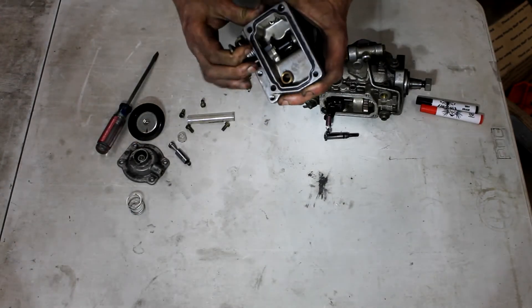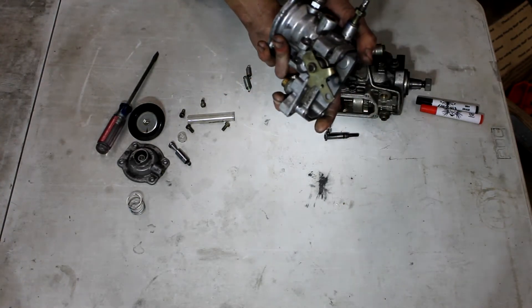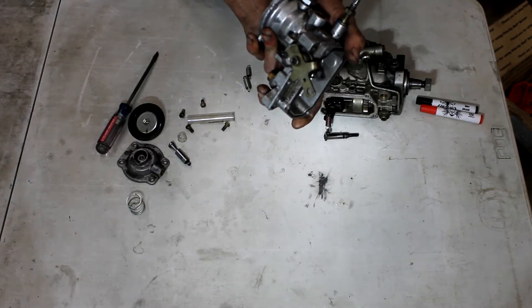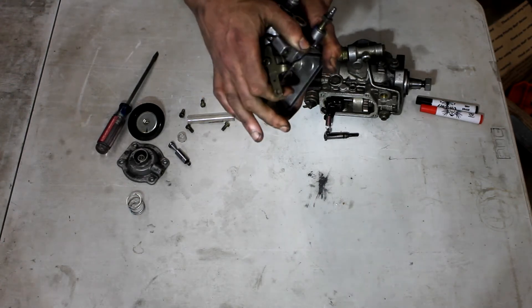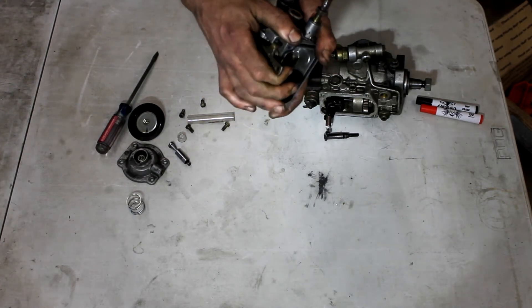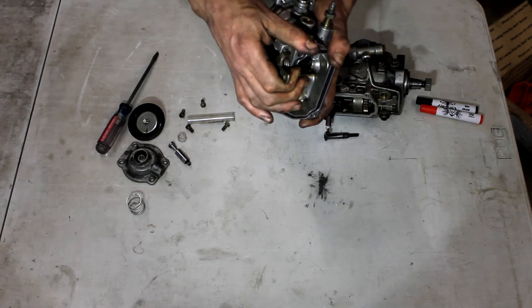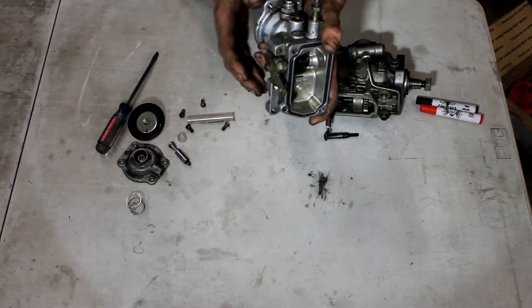This is your mechanical shutoff. When this is in the truck and you don't have the electronic shutoff working or there's an emergency, just pull this lever back - it will shut the truck off every single time. This puts the fulcrum lever in the spill port always-open position so the system will always dump fuel and not inject anything.